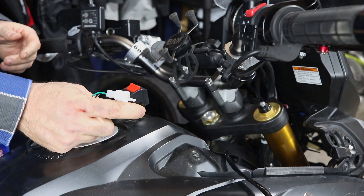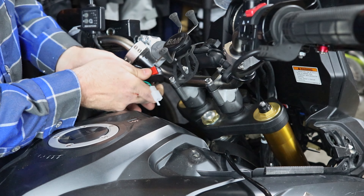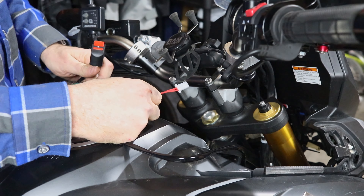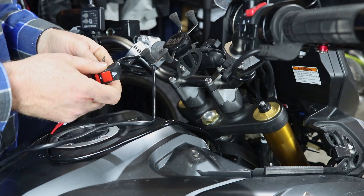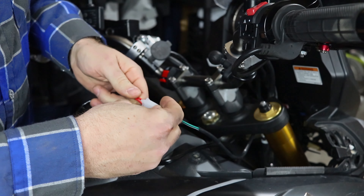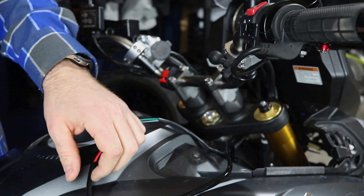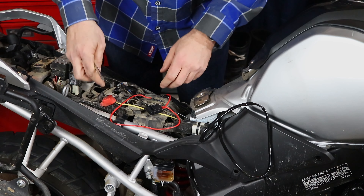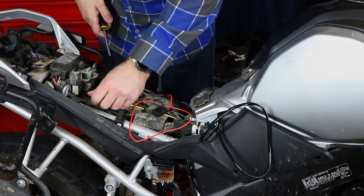So we have the switch now. After a little looking, I'm probably going to put this right here next to the clamp. I've already got too much going on on these bars, but I want it to be accessible and not block anything else. Let's see how we can run this wire. This just uses a Phillips screwdriver. We'll attach this, and then I'm going to have to clean up this rat's nest over here. These wires are actually a bit long — I may pull this one back through underneath because I don't have so many wires up front. Now we've got our lead to our battery and our other lead to the battery — our negative and positive. We'll just pull off these lead screws.